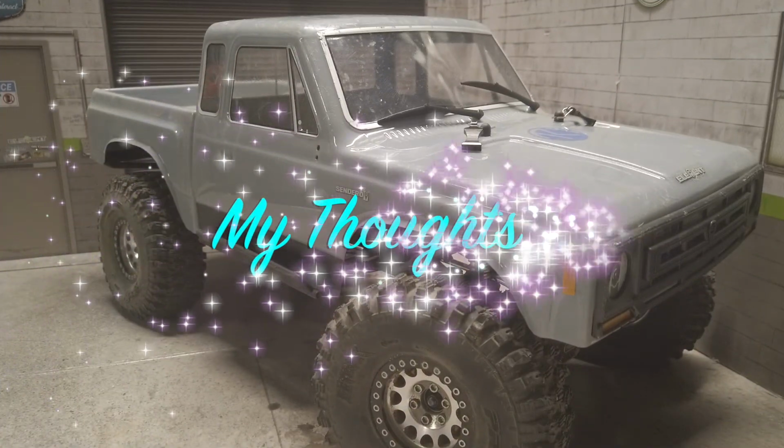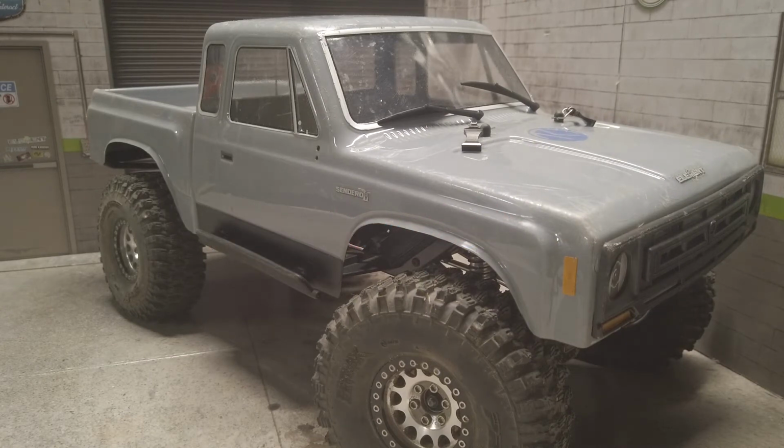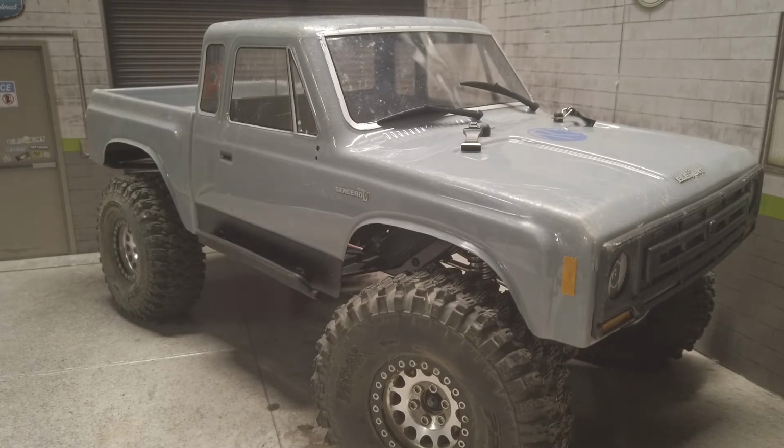As expected, the additional weight to all four corners stabilized the chassis and provided a bit more traction to all four wheels. It gave a more planted feel overall, especially in the rear. With 11.83% overdrive, the one downside is that it increases the rear-wheel slippage, especially when side-hilling. The additional rear weight definitely minimized the rear-wheel slippage.